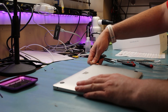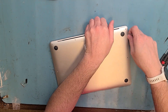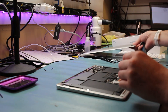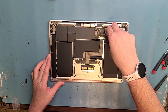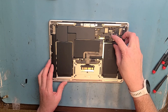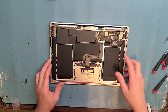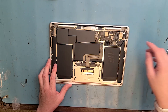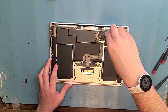Get the metal pry tool underneath here — you can see I got it lifted up, work my way around. Lift it up here, there we go, it just popped out. First thing we want to do is disconnect the battery. The battery connection is right here — lift the little lever with your fingernail or plastic spudger, lift that, then disconnect the battery. Now disconnect the wireless antenna for your Wi-Fi. Get the T3 screwdriver out and unscrew the connection first.